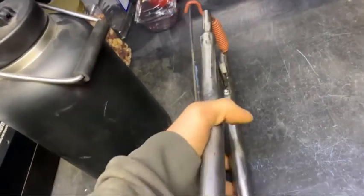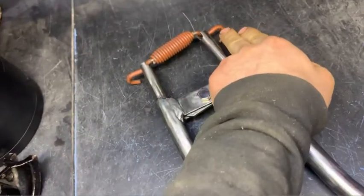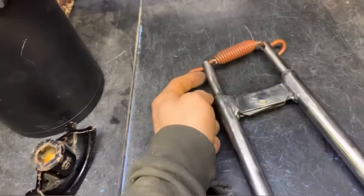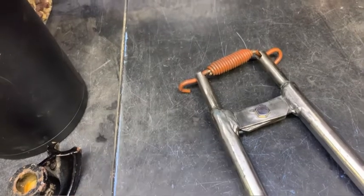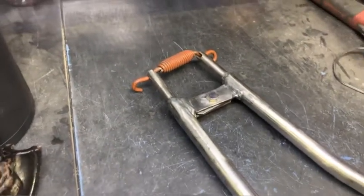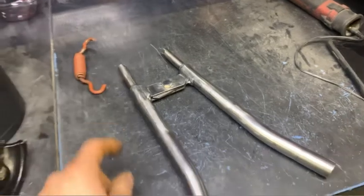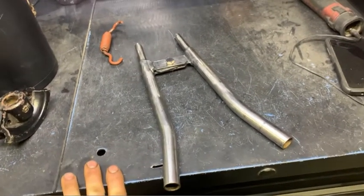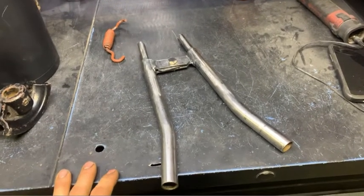I bent these using a die from my tube bender - just set it between two four-by-fours on the press, set the die on there, and it worked perfectly fine. It turned out pretty good. It's pretty tough to do with one hand but you can see the action going on. To make it fit the second spring, I think I'm going to have to weld a small notch on one side and probably a stud on the other side to brace against the opposing brake shoe. I need to get a truck in here and measure out the spring setup.